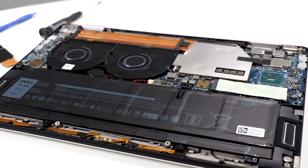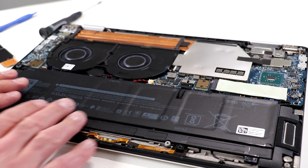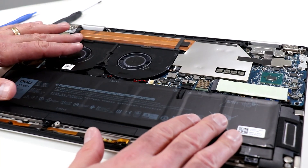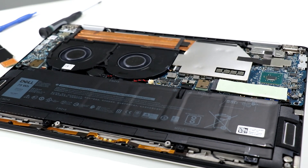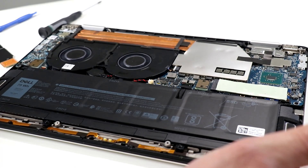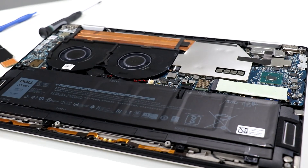That's really about it — that's all that's user-accessible and serviceable in the Dell XPS 15 2-in-1. You get access to the battery, you can clean those fans with compressed air, and access the storage if you'd like to upgrade the NVMe SSD. RAM is not user-upgradable. Make sure you stop by hothardware.com for the full review and check out the full video review on YouTube. Hit thumbs up and subscribe if you liked this quick teardown — I'm Dave Altavilla for Hot Hardware.